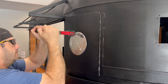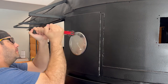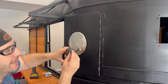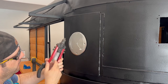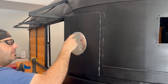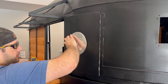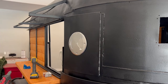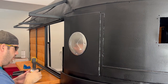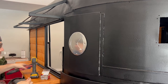All right, so it's in there. This is pulling that stem. Now it's popped. See that? The stem is actually in there. This one will fall down in there, see? Boop. Now it's down in this catch deal, and you have a rivet that is on your vent. And you can adjust and go around as you need. You can wallow out the hole with the drill if you need to, but that's essentially how you put a rivet on something.